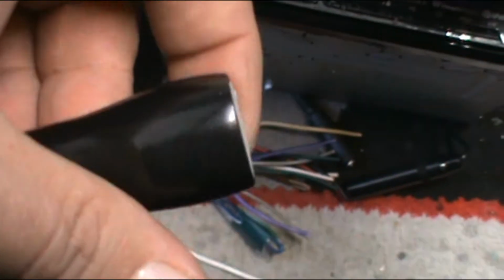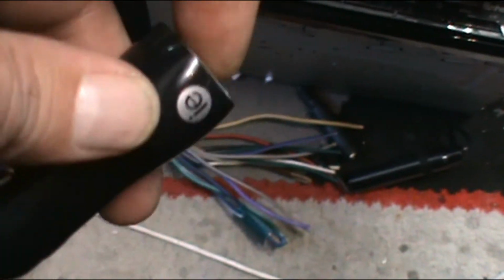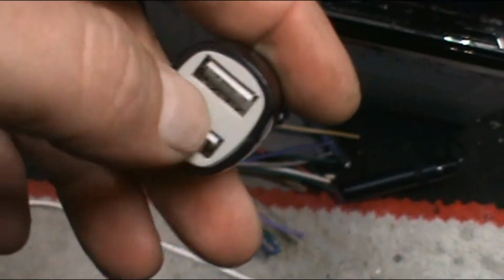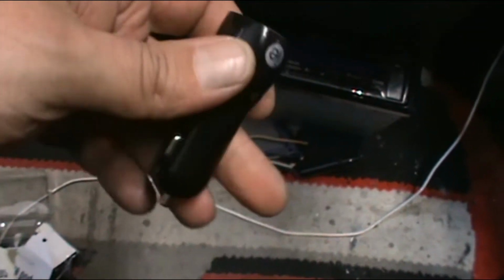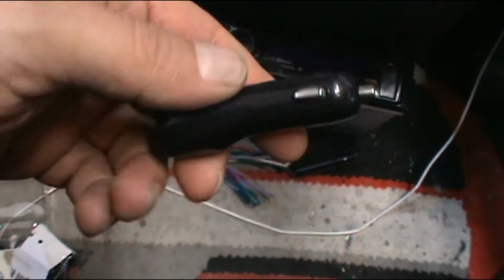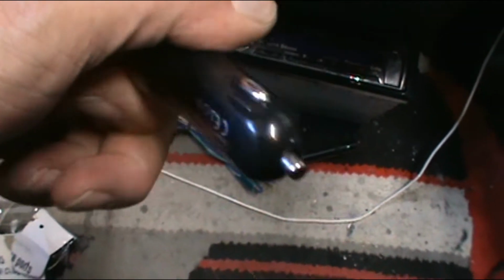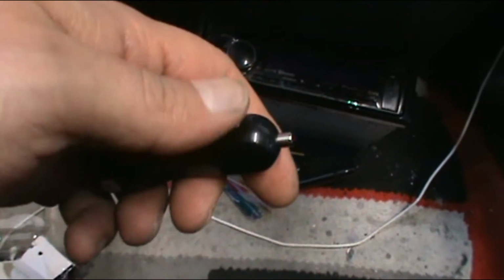It has the RCAs, has two blue wires. We put those together. And those will connect here, so when this turns on by the stereo, it'll send the 5 volts from here to the amp. That should eliminate the popping. No need to buy the $20 or $30 adapters. These you can get for like $5. Pretty cheap, so I'll show that process.